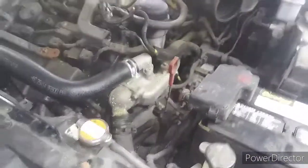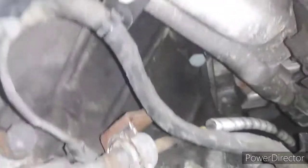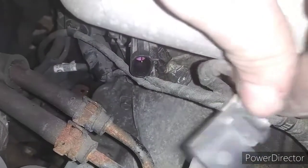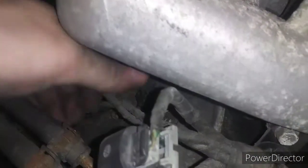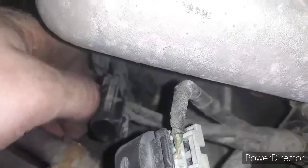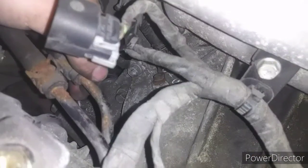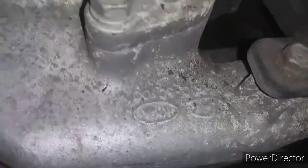Okay guys, I don't have it out yet, but I did realize something. Even though the Kia engineer screwed us by putting the sensor in such a hard-to-reach spot, they made it a little easier by putting a jumper wire right here underneath the thermostat housing so that it's a lot easier to unplug. This plug right here runs all the way down to the sensor, which is really hard to get your hand down into to unplug.